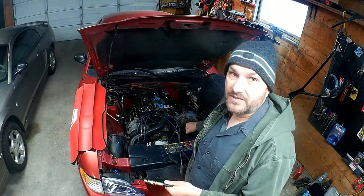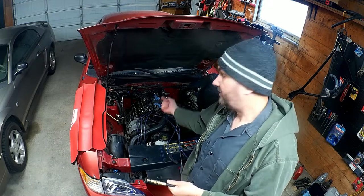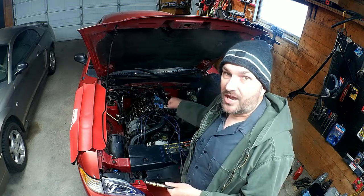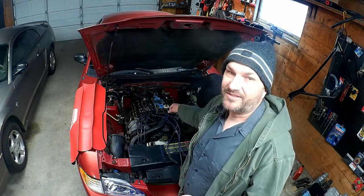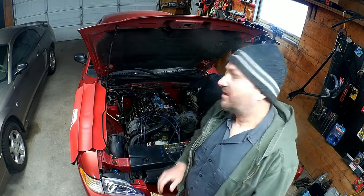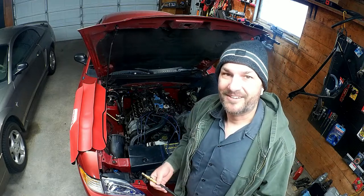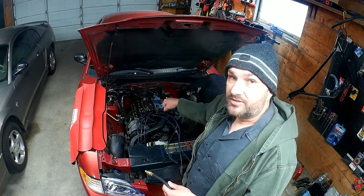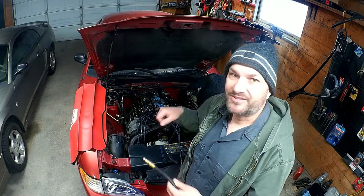One thing that's important next, after I have screwed that in, is if you have been using a wrench of some sort to turn the crank bolt in order to get the cam where you want it to be before removing the rockers, that was a step we did earlier, you want to make sure you take that wrench off of there. In fact, if you work in a shop, you probably already know this. You never leave a wrench on a crank bolt or anything else that's going to spin, because if you hit that starter or if anything else happens that starts the engine, that wrench is going to fly around in there and violently, real violently, like break your arm, make a real expensive mess under the hood kind of stuff. So whenever you're going to do anything involving turning the crank with a wrench, when you're finished, you take the wrench off of it just as a precaution, just as good practices.